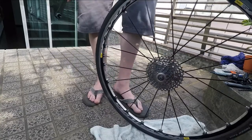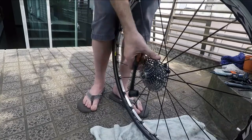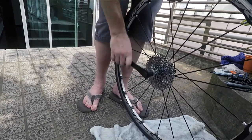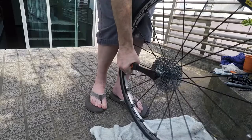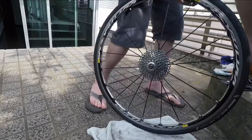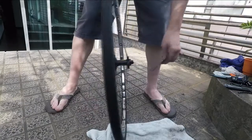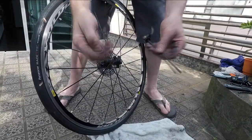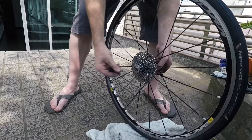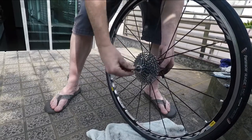I like to double check it here — yep, everything's back and cool. Almost good as new. And the sound went away. I think this is a Mavic thing, but that's it. Just put a light oil in there. It tends to wear away and you'll get that grinding — the Mavic grind, or whatever they call it — out of your freehub area.